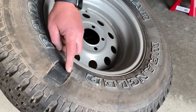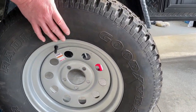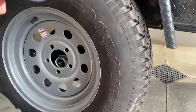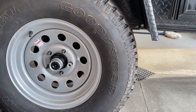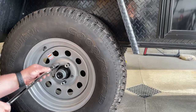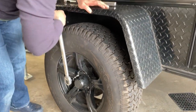The side with the blue Wrangler that was against your trailer is going to be on the inside. The part that was hanging down is going to be on the outside. Once your lug nuts are in place, remove the two-ton safety jack and lower the trailer back down with your rear jack. Now your trailer is back on the ground.